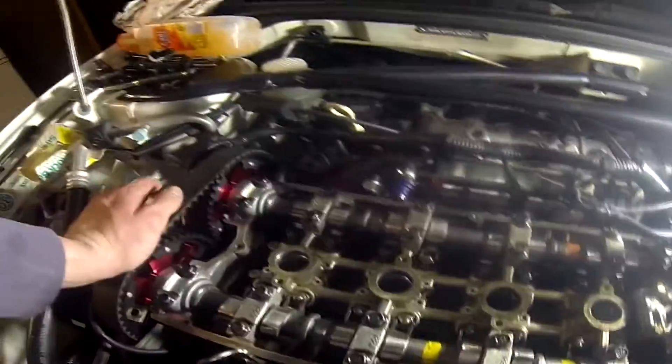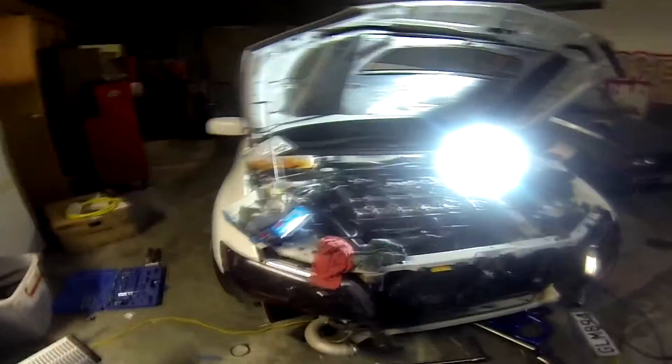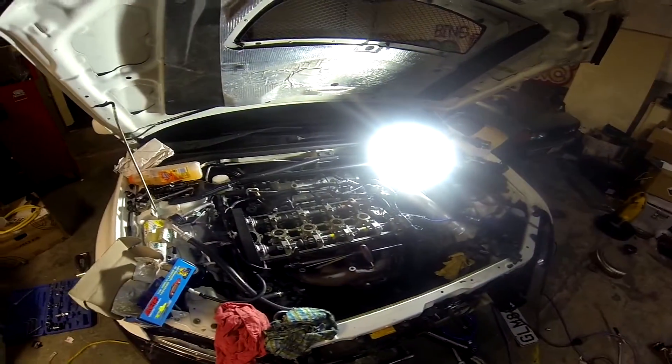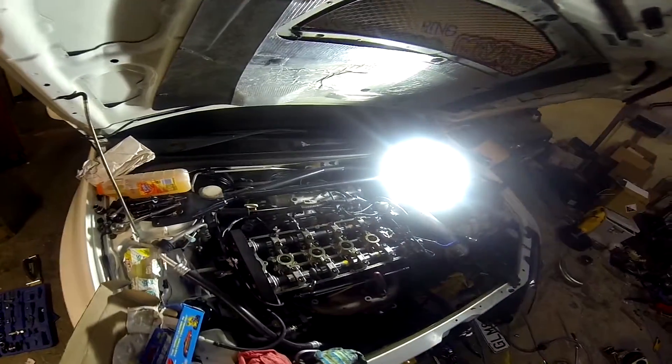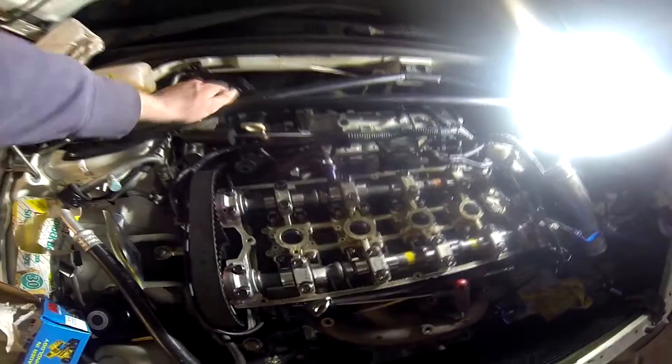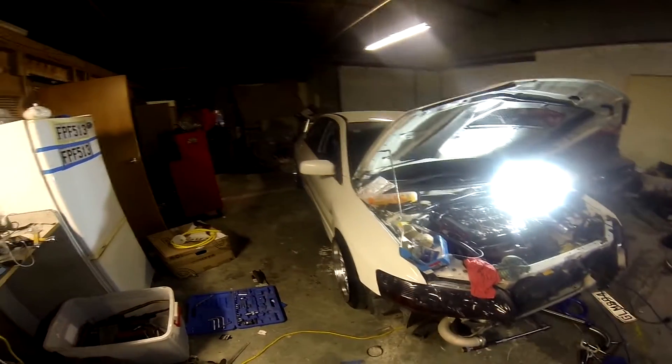And that's it, all done. Just need to put the valve cover back on, and when I eventually get it started, run it up for 15 minutes, let it cool right back down again, and I'll probably recheck the torque just before I go for my tune. There's all the stock head bolts — no time for those because we want to run more boost. It honestly takes about 45 minutes if you know what you're doing, but basically anyone can probably do it. No big job, especially on the Evo — it's pretty straightforward, you don't have to take any of the head stuff out like cams etc. as with other engines. See you in the next video.